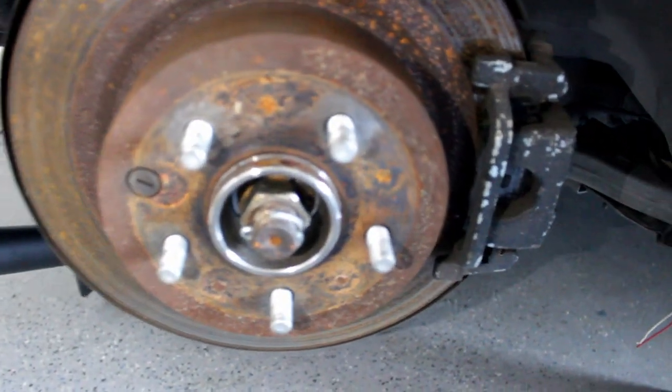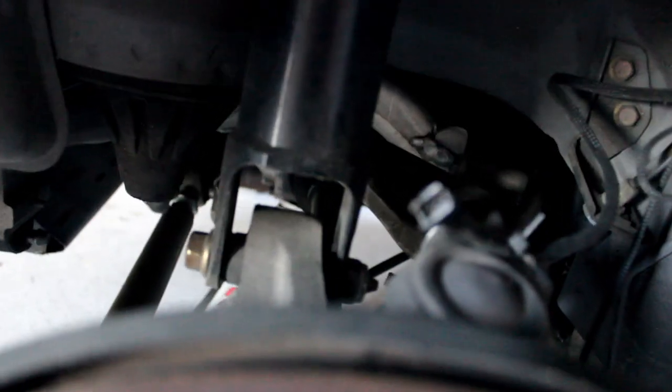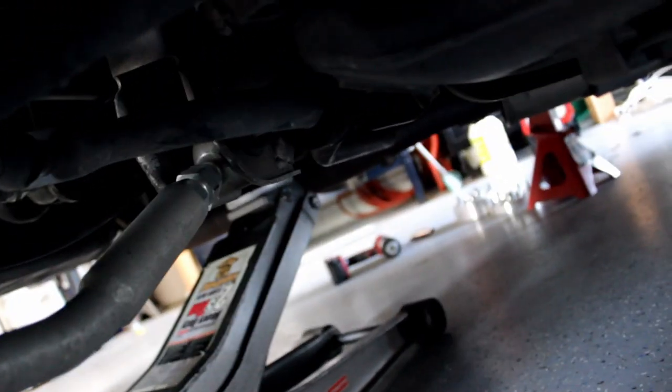Then I'm going to adjust the parking brake on this side. So on this car, I do have aftermarket components on it, but the sizes I need right now: this bottom lower strut on this side is a 17, and the nut on the other side is a 19. Everything else — like these down here and on the inside, same thing — those are all 17s. And then the top strut connectors, those two nuts right there, those are 14s.